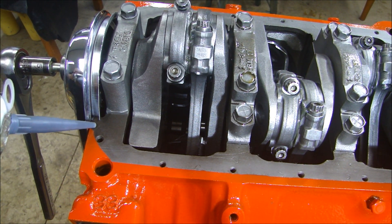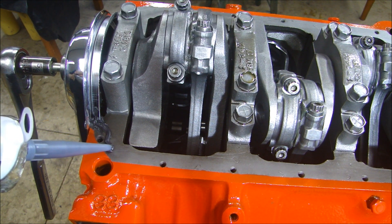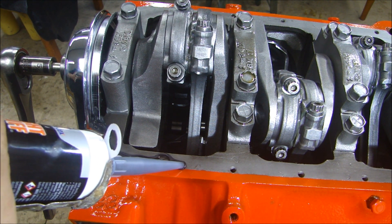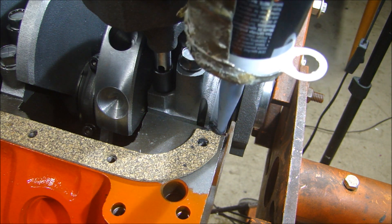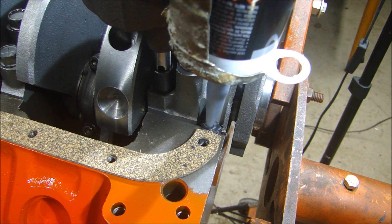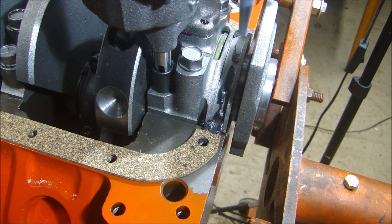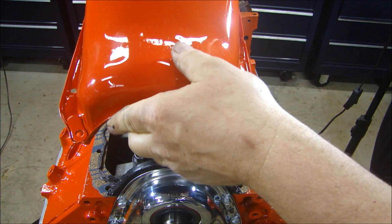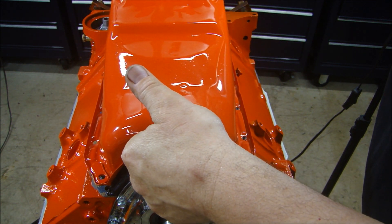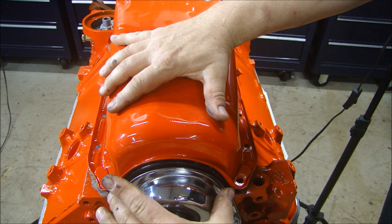I'll start with a small bead of my Right Stuff here, but I'm going to want to focus up on this front area where those two tabs meet right there. I'll just run a bead all the way around the perimeter where the gasket goes. I have the pan gasket in place, so I want to put some RTV in here to make sure that this seals in the corner — because this is where it'll leak if it'll leak. I'm just going to run a small bead across the top and down the other side, then run that in with my finger to make sure it seals really well. Have all your fasteners ready and gently put the oil pan down. As you push down the front, make sure that the gasket stays in the center — you don't squish it out one way or another.